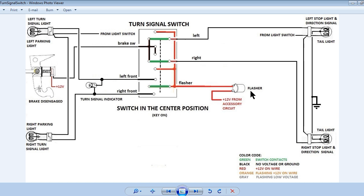This is because the flasher is a current operated device which requires current flowing through it in order to operate. Inside the flasher is a bimetallic operated contact, much like the contact in the thermostat in your house. When current is flowing, the bimetallic actuator will heat up and bend, which opens the contact and stops current flow. With no current flow, the actuator cools down and the contact closes again, allowing current to flow. This repeats, causing the bulbs to flash. Note: when you switch all your signal bulbs to LEDs, they do not draw sufficient current to heat the bimetallic actuator enough to open the contacts, leaving the bulbs on steady. A solid state flasher for LED conversions is available.